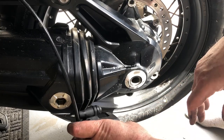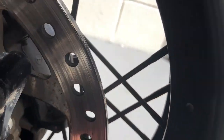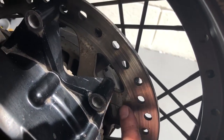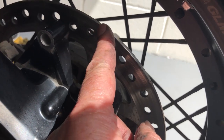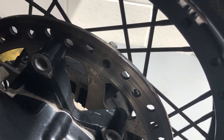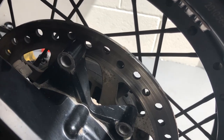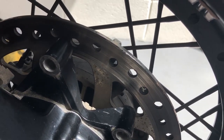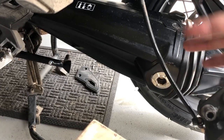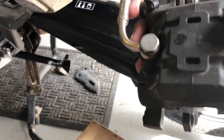Next step. You can tell it's a fairly regular disc — you can see a bit of rusting here, it's just going to be a regular steel disc, nothing special. So I wouldn't go and put any HH pads on it because it'll just eat the thing to death. This thing's barely worn on the original pads. There'll be a minimum and maximum thickness for these discs — you want to measure them with a micrometer, not a vernier, because you'll hit the lip with a vernier. I know it's going to be nowhere near its minimum thickness so I'm not even going to bother measuring it — it's only got 20,000 kilometres on it. Everything here is nice and clean so before I touch anything I'm going to go and wash my hands and get every last bit of grease off.